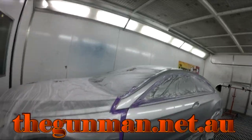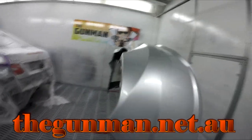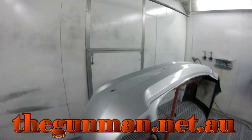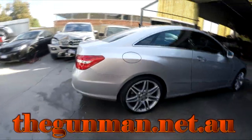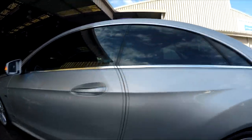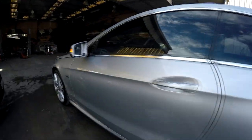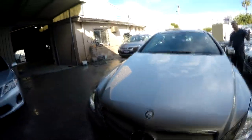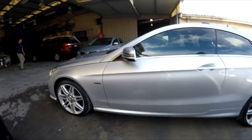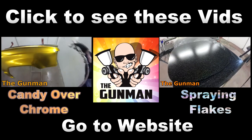This is the job as it is off the gun — it's actually quite clean, only a few dust nibs in it. You get to see the car being detailed and washed up; the panel beater is putting the moldings on the door and quarter panel. Just take note of the driver's side quarter panel versus the rear bumper bar — the color is actually quite good there, whereas the side I painted the quarter panel and bumper bar is a little bit out. I think I can put that down to going a little lighter on the quarter panel, worrying about those fry-ups. Yeah, it's a touch darker on the rear bar — no different to the front bar though. Hope you enjoyed the video — get out there and paint some sh**!